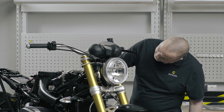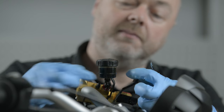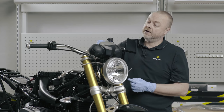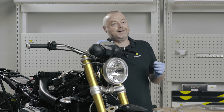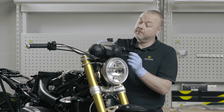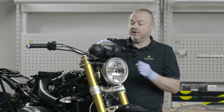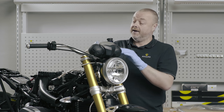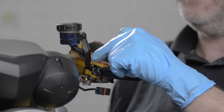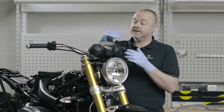In terms of connecting the clutch switch to the BMW wiring loom, it's always a good idea with BMW motorcycles not to cut into the wiring loom because they operate with a CAN bus system. What I generally do is get a clutch switch from the BMW dealer, cut into the back of that switch, solder the wires from the Magura clutch switch into the back of the BMW switch, and I then have a plug-and-play connector to the BMW wiring loom. I then adjust the master cylinder, put the motorcycle back together, put the mirror on, and the lever ratio adjustment is something I'll show you on the brake side.